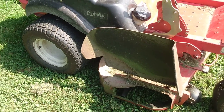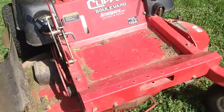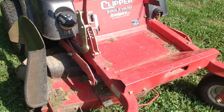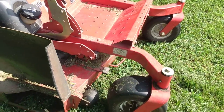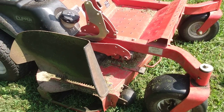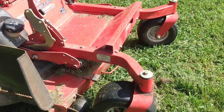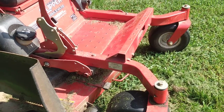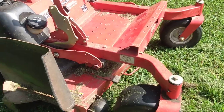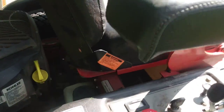Most of the stuff on this lawn mower is serviceable — the wheel bearings and caster bearings are both serviceable. That's an advantage and disadvantage: done correctly it'll have a lot longer life, but if you're neglectful, especially buying a used lawn mower, you run the risk of having to replace them. I did have to have the front bearing replaced pretty much soon after ownership, about 50 hours in. I don't know if the gentleman before didn't grease it properly or if the dealership did not. I haven't had any trouble since then, and it has about 250 hours on it now.